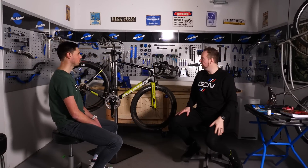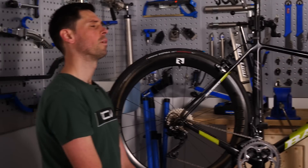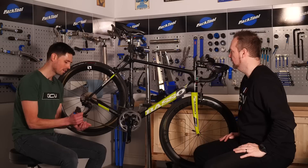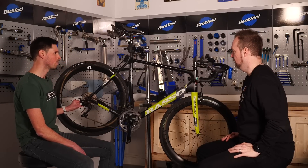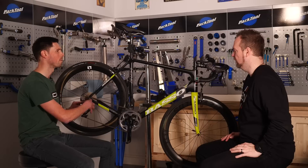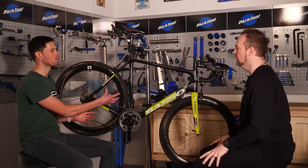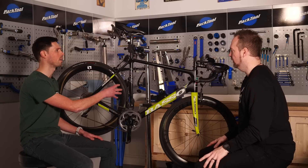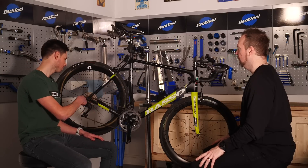How are the gears on your bike? Absolutely fine, to be honest — not really an issue, working pretty well. They don't work anymore. First thing we need to do is undo the cable pinch bolt on the rear derailleur, then do the reversal of fitting it because we need to get the cable out. Grab a 4mm Allen key.